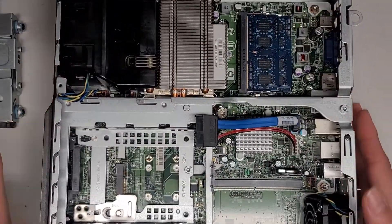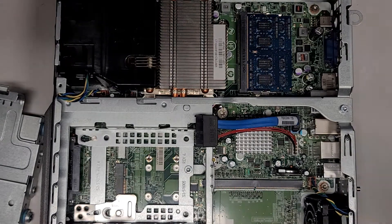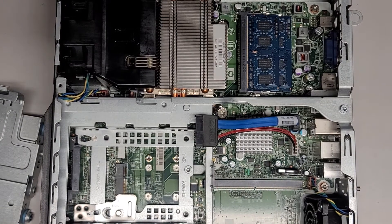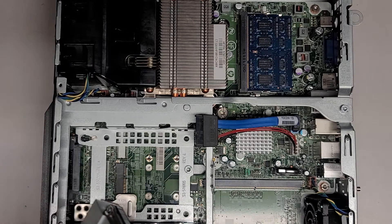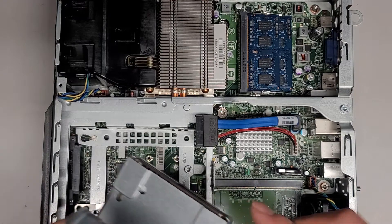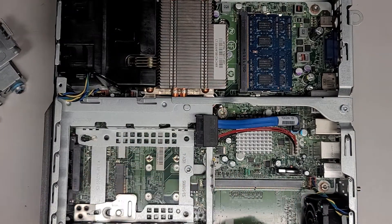Let's go ahead and find out what screwdriver we need to take the hard drive out and put an SSD in here. We've cloned everything over to this SSD — it's 480 gigs. There are different models; if you need help finding one, feel free to let me know. This is pretty big — it almost fits a T20. Maybe it's T15, Torx 15 screwdriver. So we're going to use a T15 or Torx 15 screwdriver.